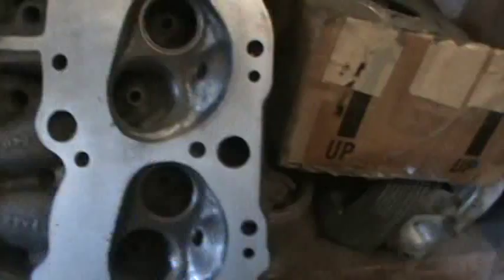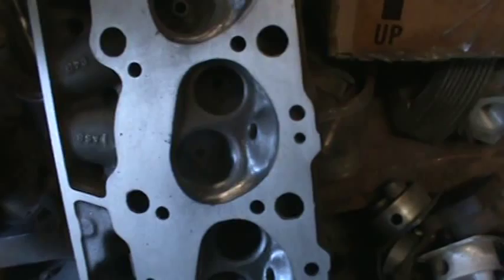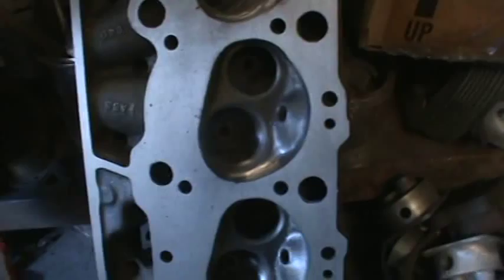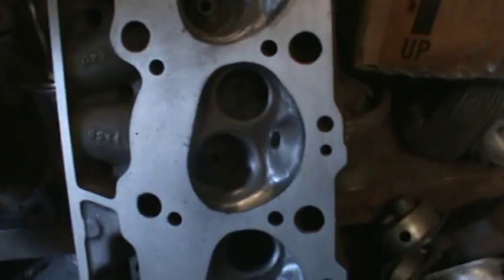The seat area is critical. You can use the carbide tip, or you can take them to the machine shop. They have a fixture that is run off the guide called a bowl hog, and what it does is go in there and machine under the seat. Usually if you get a performance valve job, they'll incorporate that into it. Because if you've got a bad bowl, it doesn't matter how good your valve job or your port is — it's going to interrupt your flow. It should almost be a straight shot when you're done in there.